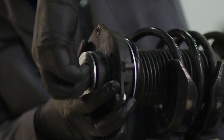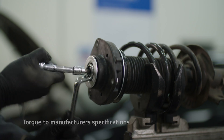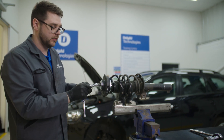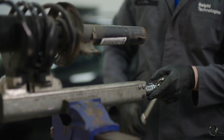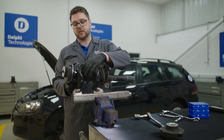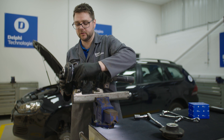On this one we don't, so we can go ahead and put it on the top and put the nut straight back on. When tightening the top mount, we should always ensure that the strut remains in the correct position with the spring at the bottom, or top if it's got lugs at the top. Now the top mount's back on tight, we can begin to decompress the spring.